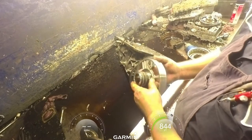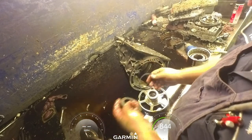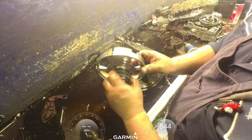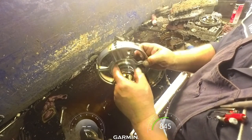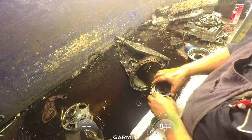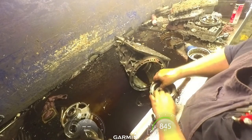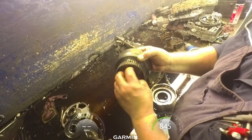You want to try to pull your center support out as straight as you can. These bearings often come apart - as long as they don't have any pits in them you can reuse them. Don't worry about the fact that it came apart. Turn this bearing right here; if it's really stiff to turn, odds are this is cracked - look in here real close, they have a tendency to crack. Forward ring gear - grab this and turn it, make sure it's not stripping out. There's another bearing inside here; I've never seen one of these crack but make sure it's not hard to turn.